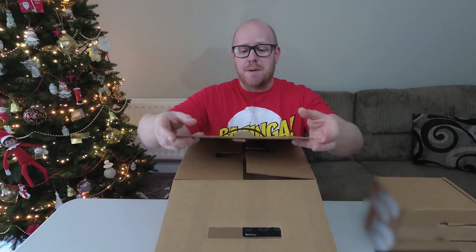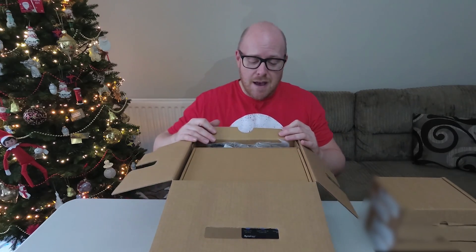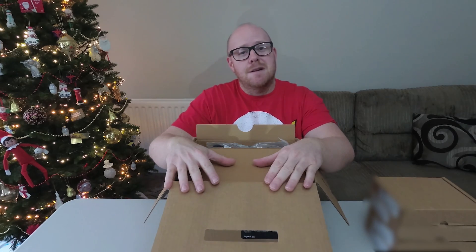I've been waiting for this — with the Vlogmas videos I've been doing I've been so busy and I've had this for a couple of days but honestly haven't taken it out of the box. If you're going to pick one of these up and you've never had a NAS before, it's something you shouldn't rush into. Think about how many drives you're going to fit in, how many can physically fit, and what RAID configuration you want — RAID 0, 1, 5, 10, or Synology Hybrid RAID SHR or SHR2. I'll cover that in more detail when we configure the device.